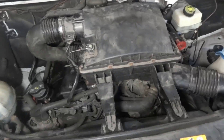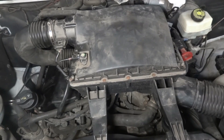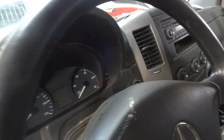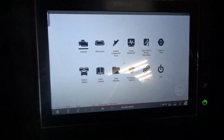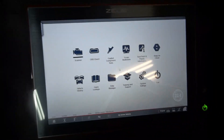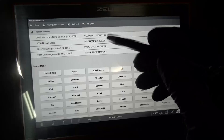I have replaced all the injectors. I replaced the injectors on the driver's side off camera, so now let's go in the vehicle and write the injectors' QR codes in the engine computer. After that, we're going to take this vehicle for a test drive. I'm going to turn the key on. I have the scan tool connected to the vehicle and my piece of paper here where I wrote all my new injector IDs. This is the injector ID of cylinder one — I'm going to show you how to do the first injector, and then I will do the other two injectors off camera.